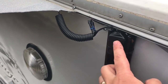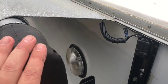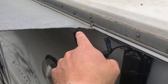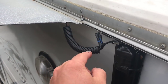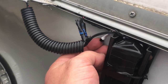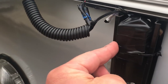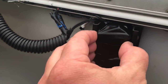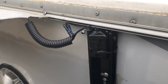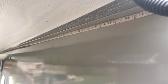Here's the finished product. I wrapped the white box in electrical tape and mounted it on the inside of the awning track. I checked several times — the awning head stops about an eighth of an inch before it would actually hit the box. I spliced into my regular awning wires, and this cord goes into the box, while this is the sensor that turns it on and changes colors. I ran the wires through some holes in the track and it's mounted very securely — you cannot pull it out.